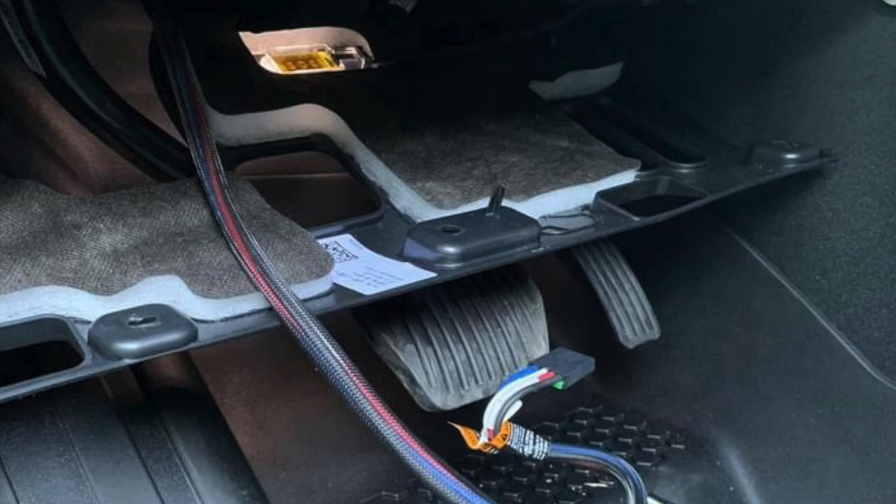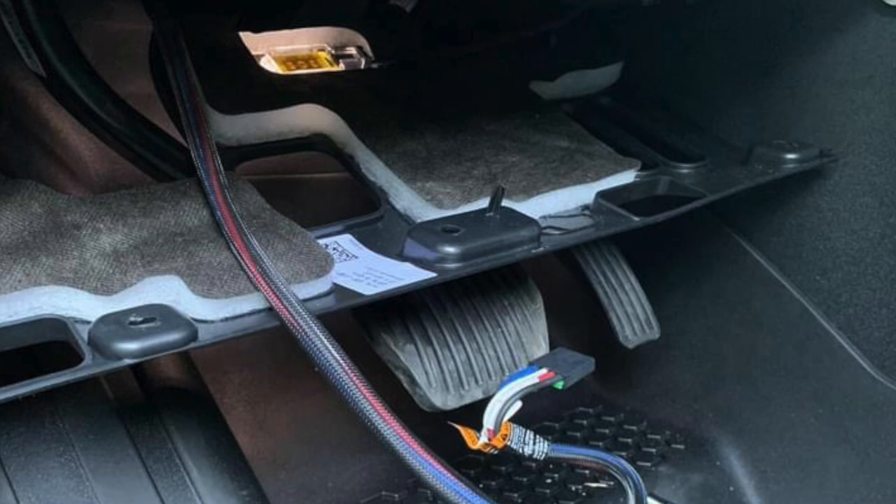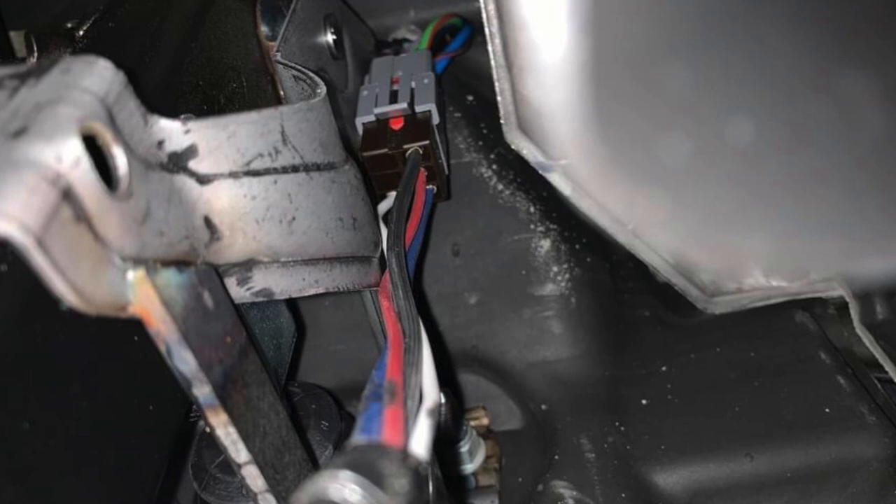It's probably out of date but it's the one I've got and it does work after a fashion. I bought it for the LR3 and there's a patch lead - a plug-and-play affair - that you have to buy from Land Rover. There's a little pigtail unit, a short loom with a plug at each end. They call it plug-and-play because you clip it into one end and clip it into the other end and all the problem goes away. That unit can be bought from Land Rover if you live on this side of the pond.